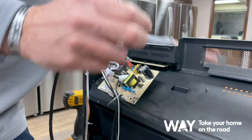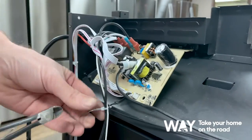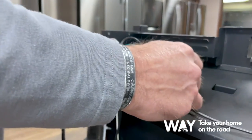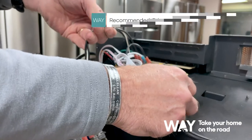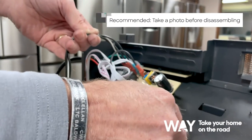You're going to want your little cutters here and you can snip all your zip ties so you have access to all your plugs, and then just disconnect each. I would recommend taking a picture first and then transfer one plug at a time to your new circuit board.